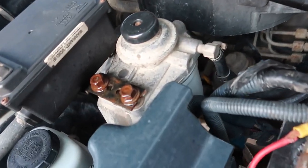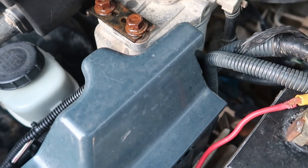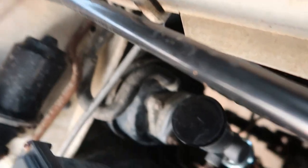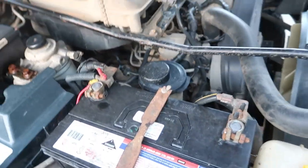Pretty much just going to undo those two 12mm bolts, and just like a flathead screwdriver down the back there somewhere, just got to unscrew that and put the new one on. Then I'm also going to show you what else I've done and probably go through a little bit of a 4WD trip, so I'll include some of that video footage as well. Right now I'm just going to undo this real quick.